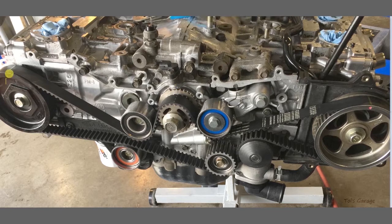This is camshaft sprocket number one. This is the cam timing mark on the sprocket. The mark is oriented at the 12 o'clock position and is also aligned with the cam cap and the cylinder head matching surface right in here. Moving on to camshaft sprocket number two — note the timing mark here. It is also at the 12 o'clock position and aligned with a notch in the timing cover right here. Once the crankshaft sprocket and both cam sprockets are aligned, the timing belt can be installed.